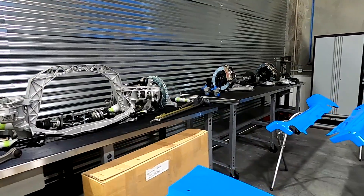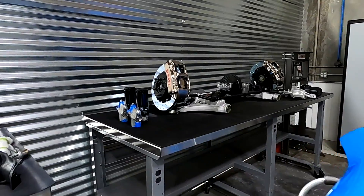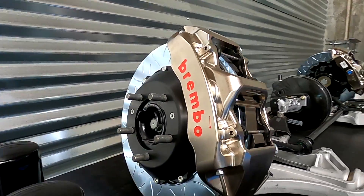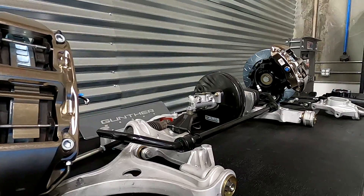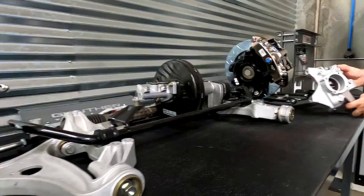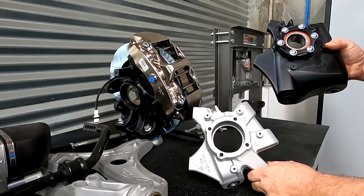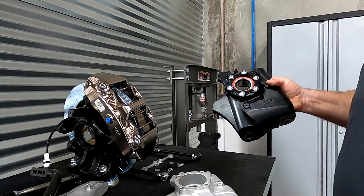The front was a little bit bigger undertaking. We changed some things — and you can see obviously to make the car stop, we've got massive brakes on this car. It's the biggest brake we could possibly fit underneath the 18-inch wheel, which is another spec that Peter wanted to stay with. This is a factory upright — a wheel carrier. This is the part that I completely redesigned and changed quite a bit. If you look at the center to the lower pickup points you can see there are big changes there.